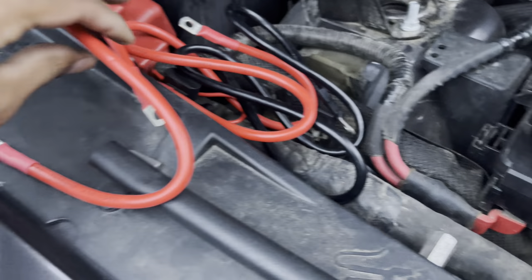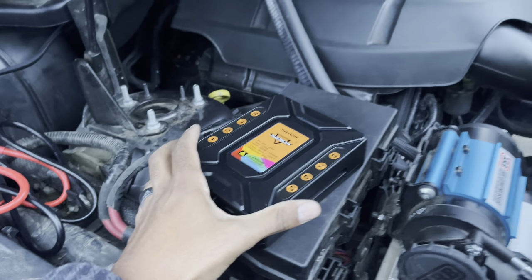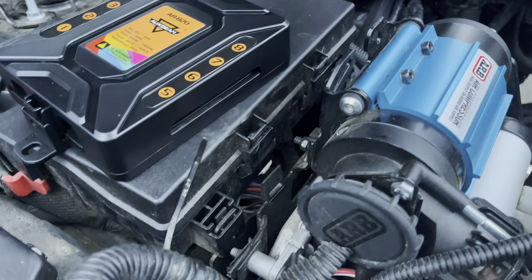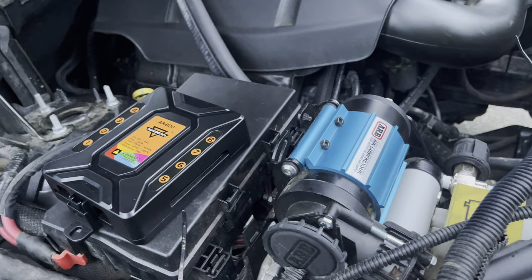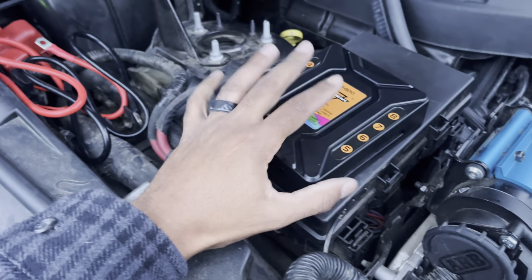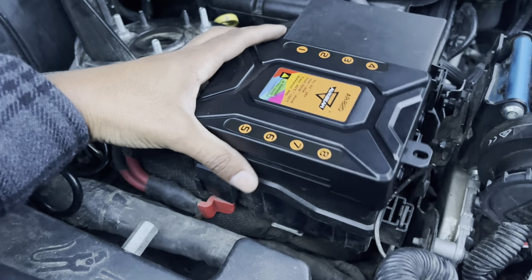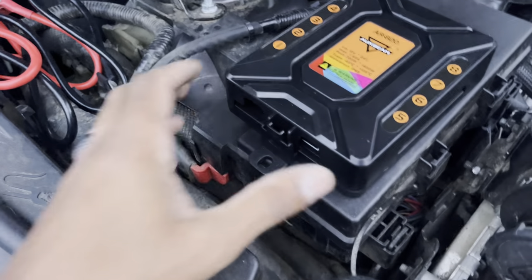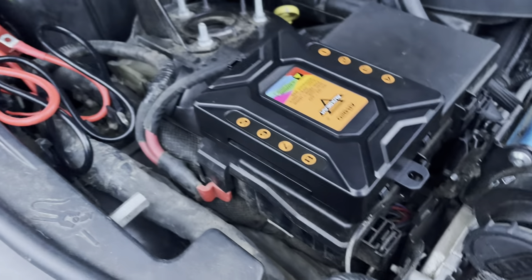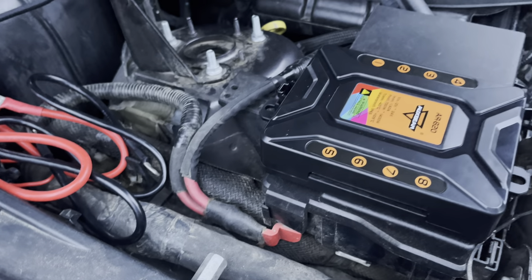Some of my accessories have multiple features so it was kind of confusing to see where the wires went, but we're going to put new ends on these and find a place to mount the new Auxbeam control. First we're going to hook up our negative and positive — hook it up in here but not to the vehicle just yet. The engine bay on the WK2 is so limited and I already have stuff stuffed in here like a compressor. I'd like to later put the compressor over there with a six monkeys bracket and move this switch panel control box right here. But for now I think we're going to double-side tape this to the fuse box. It should clear just fine — it's not my favorite place, but I'll still be brainstorming other ideas.